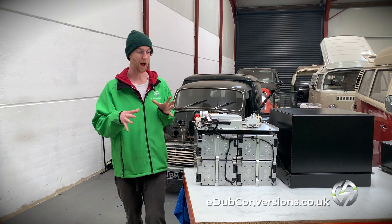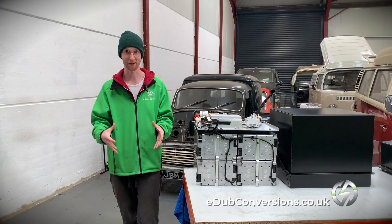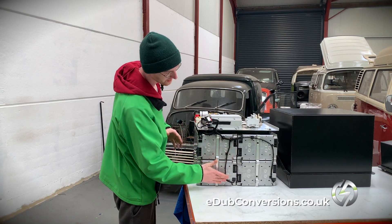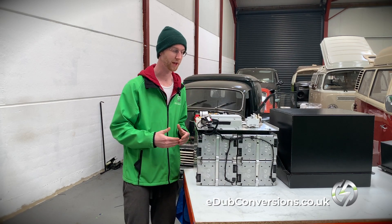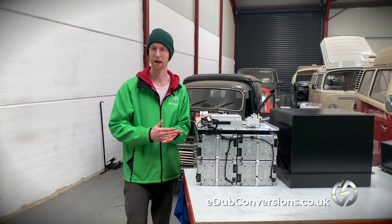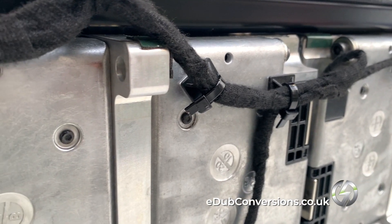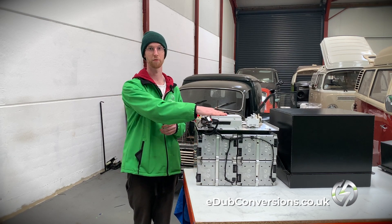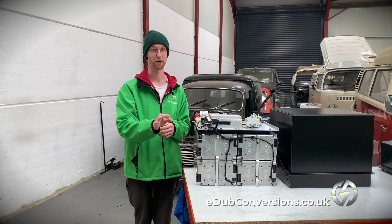What I'm really excited about with this build is how tidy I've been. We've managed to P-clip and tidy back all these cables, make sure they're nicely wrapped and not rubbing on anything, to ensure that none of these cell tap harness looms are going to short together or short to chassis. That's really important mainly for the protection of the battery — if any of those short, you may well blow a fuse in the battery or even worse, blow a fuse in the battery management system. And that's not fun — trust me, I've done it.